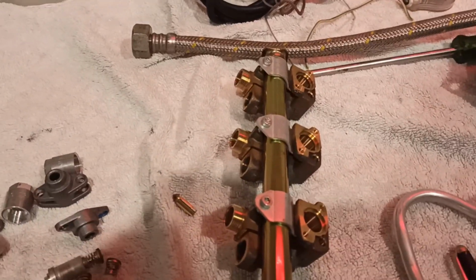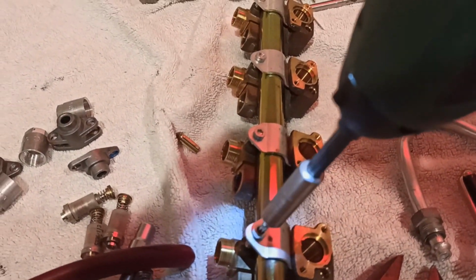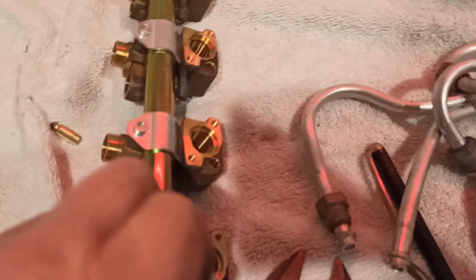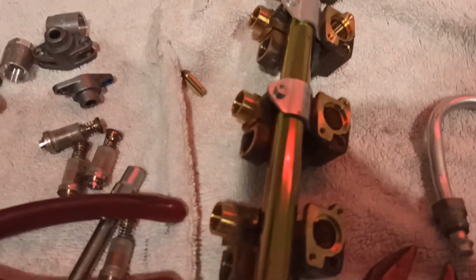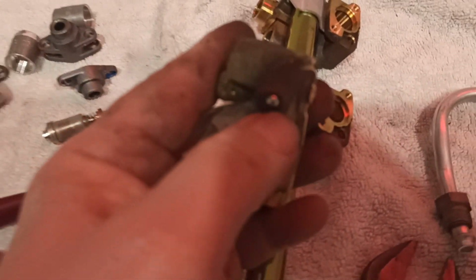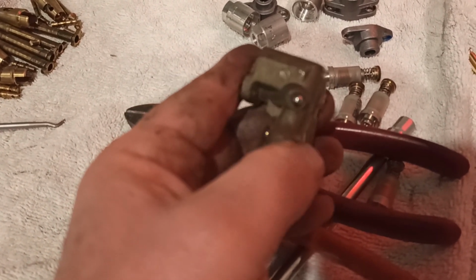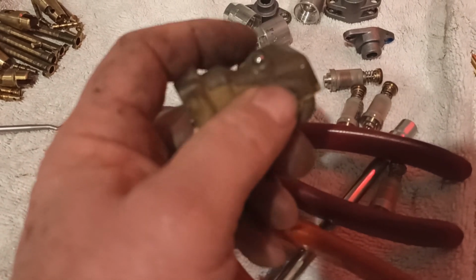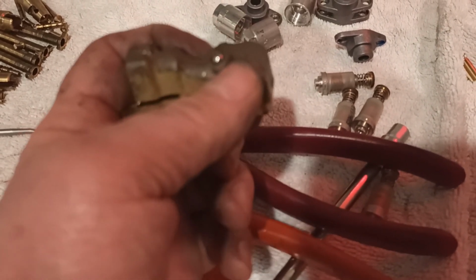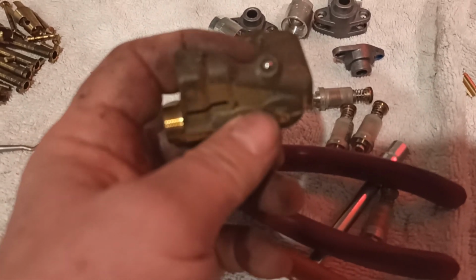Now we're on the home straight, and all we've got to do is get our little torque, undo the valve. This little top fella is mild steel. Here's our valve, and that, as far as I can, well, no, it's not a clean valve, because right there under my thumb tip is a ball bearing, a steel ball bearing. And what I did last time was I just got out an angle grinder, and I just came in on an angle like that, whacked a screwdriver in there, prised it out, job done.